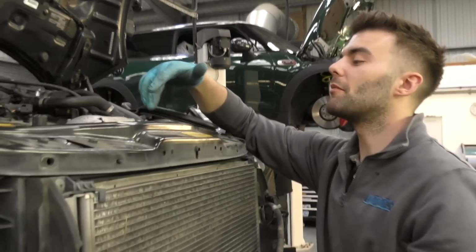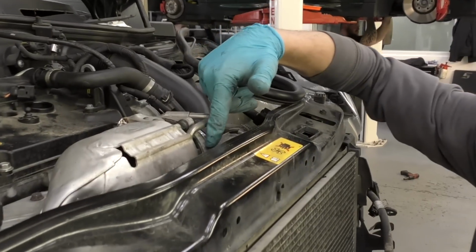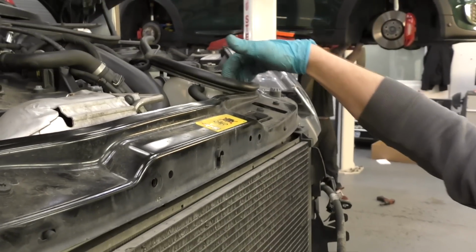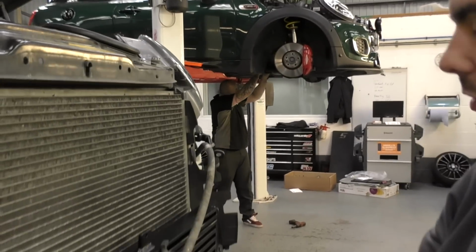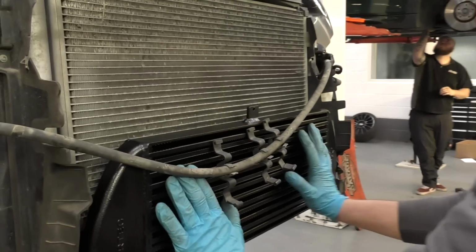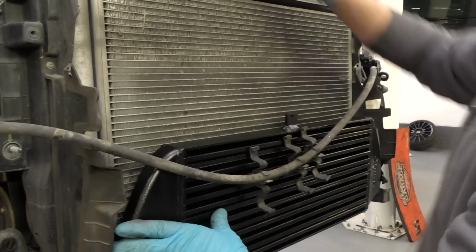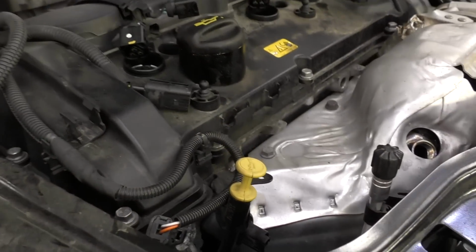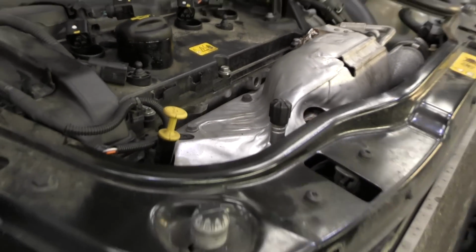I don't know if you want to shine it up here a little bit. Through here, down through this intercooler pipe, it just goes down the back of the radiator. Comes down to the bottom of this intercooler, across, air comes in, cools your air through here, comes back up through this hard pipe here, into your inlet manifold, and obviously into the chambers.